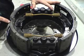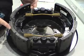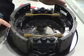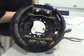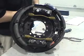The easiest way to do it is to set them up by rotating the wheel — tighten them up until they just start to drag, then back them off until they're free rotating. When we're done, we can see the operation of it just by applying a little bit of air to the system.